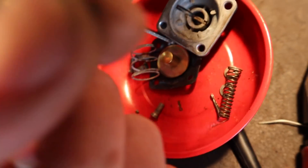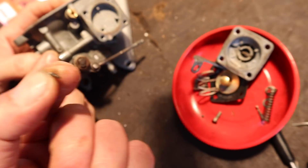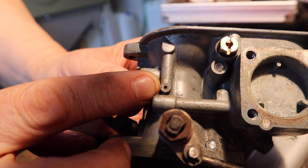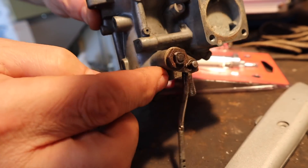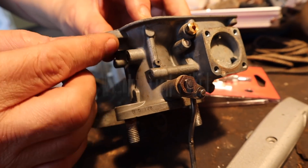That tiny little pin here — if you come here. Hold on, because I can't see the little pin. Oh yeah, in that hole there. Right, that goes into that little hole there, you see? Which then — there's a ball bearing that sits down into this chamber, which is the pump chamber. The ball bearing was seized at the bottom, not allowing fuelling.